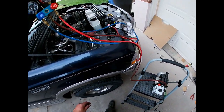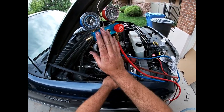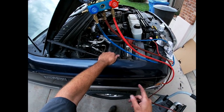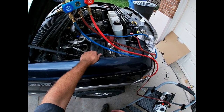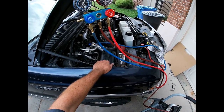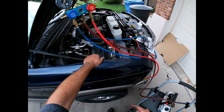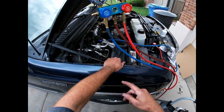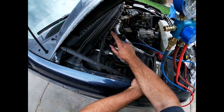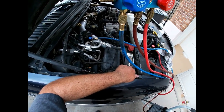Now, this is a vacuum pump, and what it does is put the entire AC system under a vacuum. It's really important to do this — you can rent a vacuum pump from O'Reilly or other parts stores if you don't have one. It puts the entire system under a vacuum to get moisture out, contaminants out, and air out. If the system only holds a certain amount of refrigerant but it's full of air, that air takes the place of refrigerant and you don't get the proper charge. But the most important function of the vacuum pump is to remove moisture. In an AC system there are parts that can run below freezing — right where the refrigerant expands and flashes to become cool. Anywhere in the system where it's freezing, if you have moisture, you'll get ice, and that ice can walk through the system and plug things up. It's super important to get the moisture out.